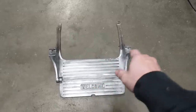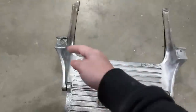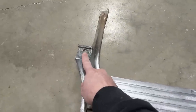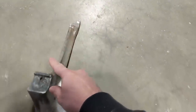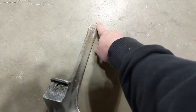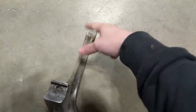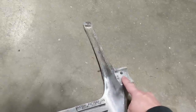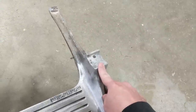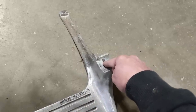So now that we know that, if we think about the step here, this broken corner makes a lot more sense. Basically, this screw here mounts to the coach, to the body, and then this screw hole here mounts to the frame. But the body here and this screw hole there are both pretty close to the rear axle, so there's not going to be a lot of sagging that happens there. The structure's really beefy. But up here, this is closer to the front of the coach, which means that this portion touching a frame member is not going to sag. But this portion here is going to have a whole lot of forces going downwards because the whole coach is trying to sag onto this moment here.